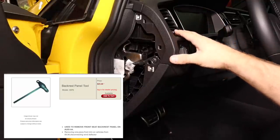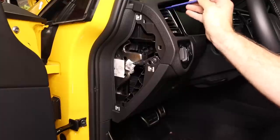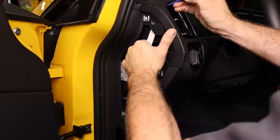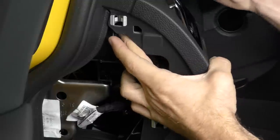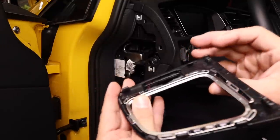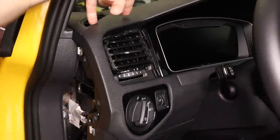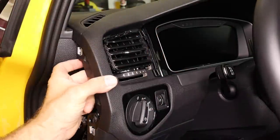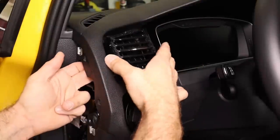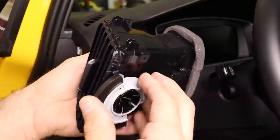There are one of two ways. If you have the special tool, you're going to go through the vent with it all the way open, grab the vent, unhook it, and pull it all the way out. What we're going to do is get back behind the vent this way and pry it out. Here's our trim piece that we do need to remove — just a couple of tabs holding it in. To remove the vent itself there are four tabs, two at the bottom and two at the top. I like to stick my hand back here and apply a little bit of pressure forward to aid in removing it. Just had to pop one clip and this whole piece comes out. We're going to be replacing this, but I'd still save it in case you ever want to go back to your factory setup.